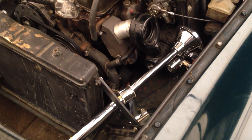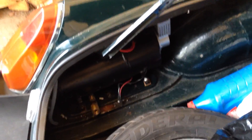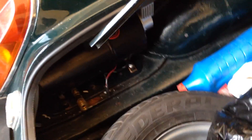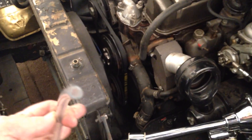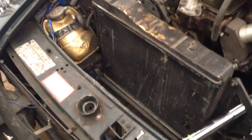What I did is I hooked up two switches — one works an air pump that's in the trunk back here. As you can see, it fits right up in there, and you'll see down at the bottom I plumbed in an extra air hose right down here, so that if I'm on the road I can also fill up my tires. This is about a 20-amp pump and it runs pretty well. Originally when I hooked this up I used plastic tubing, but I went through two batches of it because it kept blowing out at around 80 pounds of pressure. So I ended up going to my local plumbing store and got a harder plastic tubing, and that's what seemed to do it. Here's the relay for the pump itself — I have the pump on a relay so it doesn't come on automatically.